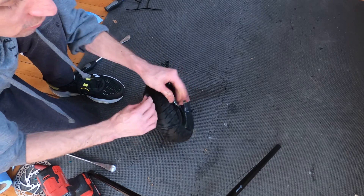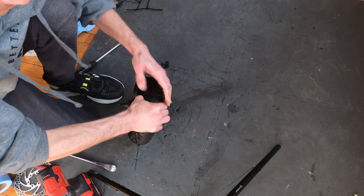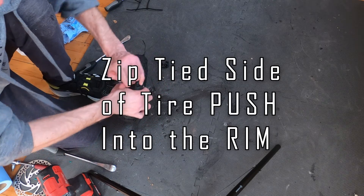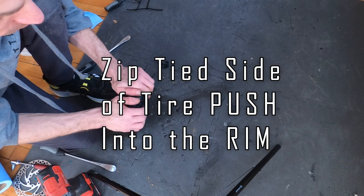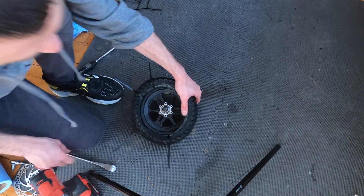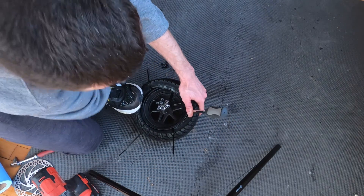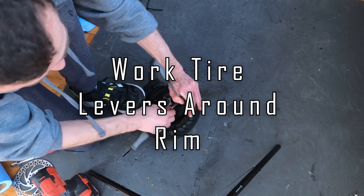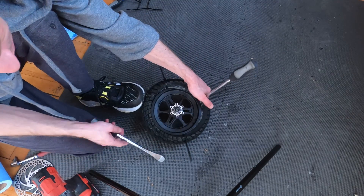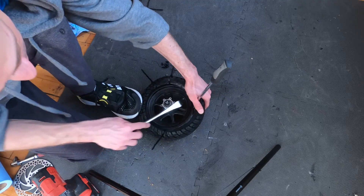You can see here I'm smashing the tire, basically trying to make it concave. Another thing is maybe I didn't have them tight enough — the tighter they are, sometimes the better your luck. I did a better job this time spreading the zip ties out. You have to be careful as you work the tire irons around — you can see it popped back out. Now we're getting close to making it fit.